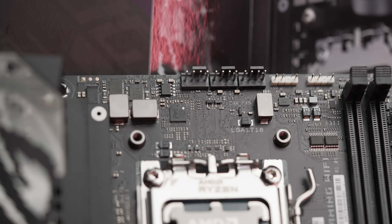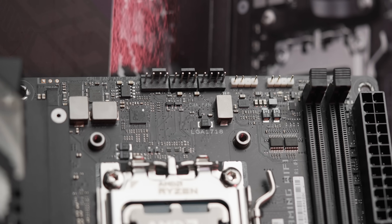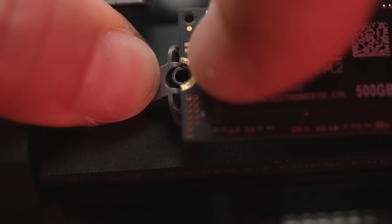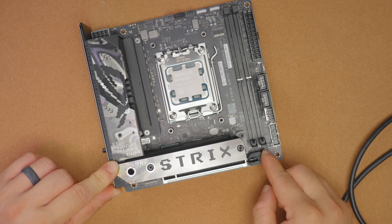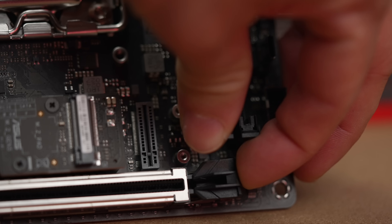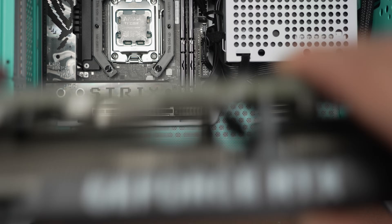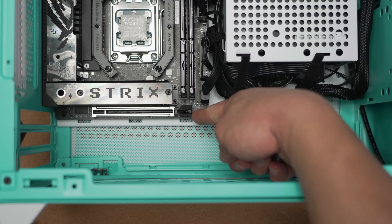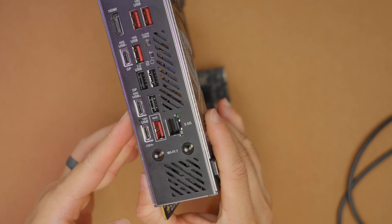The layout is another plus — this is not easy for board design especially for mini-ITX. ASUS continues to place all three fan headers at the top and two ARGB connectors at the top, which makes building and cable management more simple. The manual touch points have been further refined: the Q-Latch is a new design where you don't have to turn it anymore — you just push it down and slide your drive in. The expansion slot release is called Q Release Slim — if you're removing the card you just tilt the card toward the latch and the slot releases the card on its own, which is a huge improvement in a mini-ITX build.